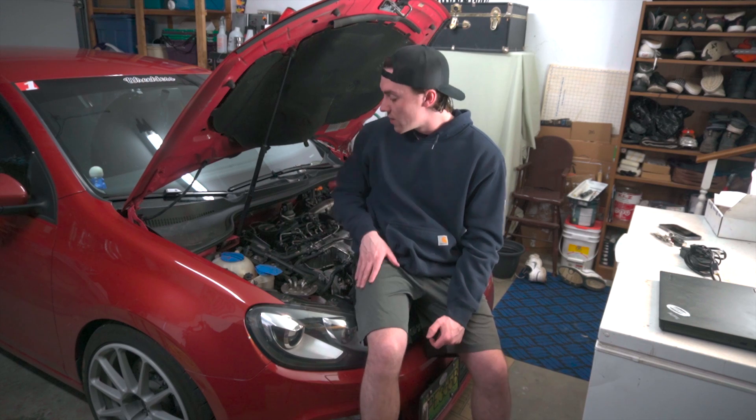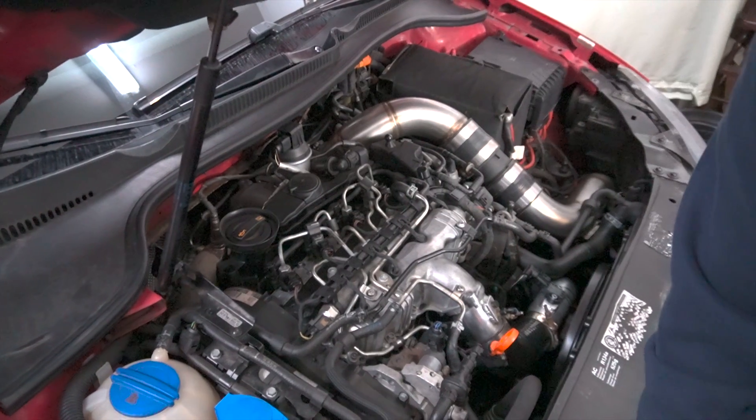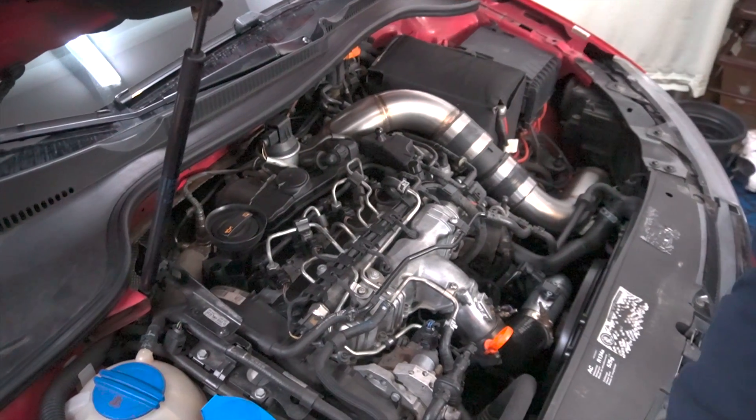I'm going to show you the install guide I'm going to be following, because there is a gent that did this on the TDI forums already — it's a pretty decent write-up for the mechanical install. I'll also show you a bit more in-depth of the VCDS stuff. Let's jump right into pulling these injectors out. This is a fairly simple install but a little bit more messy because we're going to be dealing with diesel fuel and the fuel rails, so make sure you've got some gloves and some rags. I'll put the link in the description.